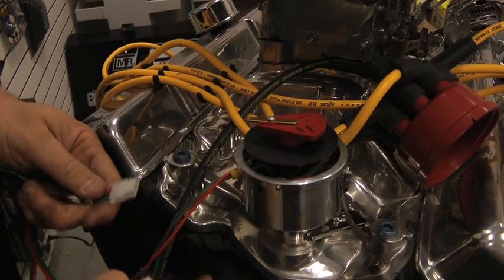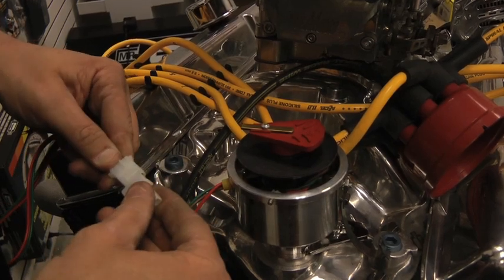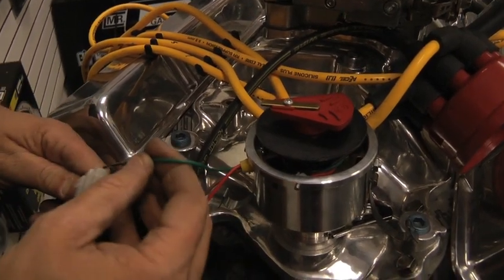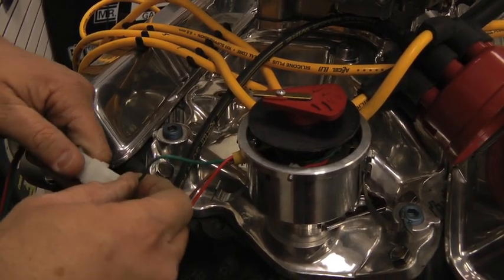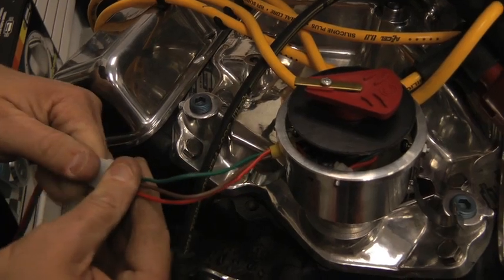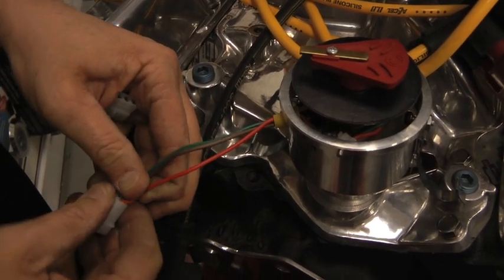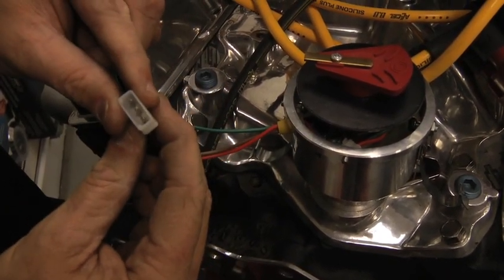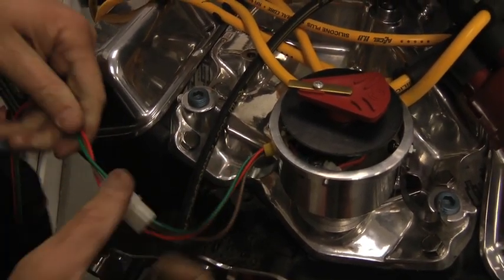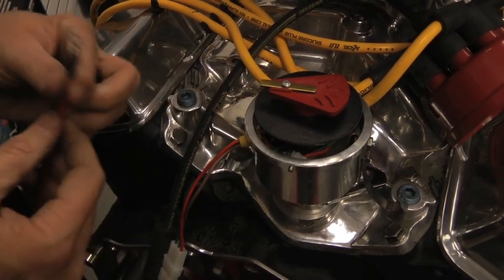It's very important when putting the plastic clip on your new harness that the wires line up so there are no misconnections. The green one goes in first, then the brown one, then the red one. Make sure they're in tight — you can hear them snap into place when locked into the plastic clip. Then connect these together, making sure the other end connects to your coil, and you're in business.